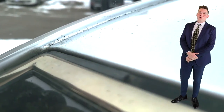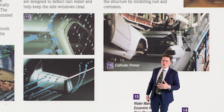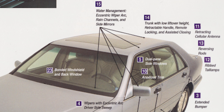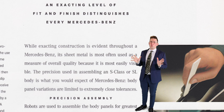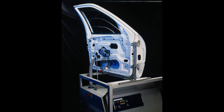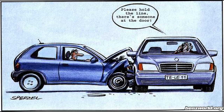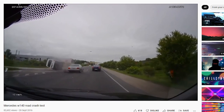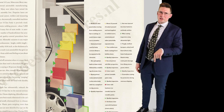They creased the C-pillar to create a rainwater channel, designed to direct rain and water away from the occupant entrance and the windows. Gap accuracy on the S-Class is within four one-hundredths of an inch. The door thickness — you know, that photo may be an exaggeration, but maybe not by much. There are a lot of steps behind it; I'll put links down below.